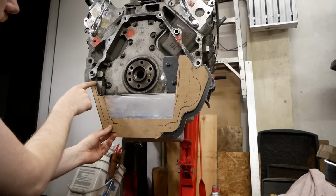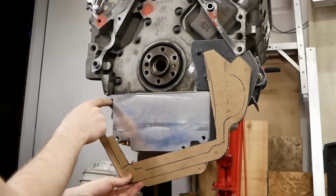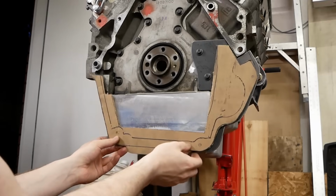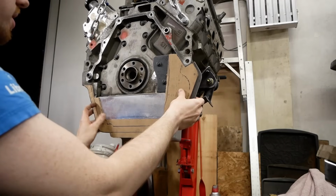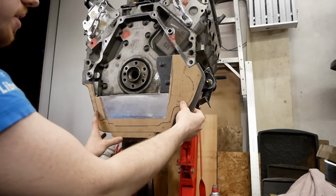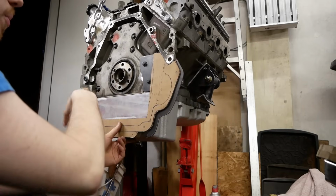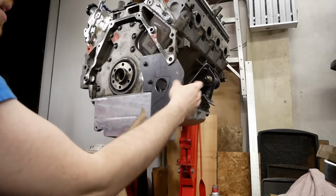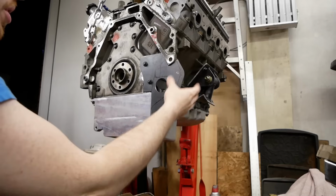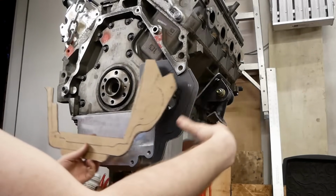And then by coming up into here, we're filling off what would have been a little hole, and another little hole, and potentially another little hole. And then this whole piece will have these two bolts, and then several bolts along there, plus an additional one here through the bell housing, all helping to hold it on, which at the end of the day is sealing out dust, but also giving us a really beefy mount for the starter motor to attach to.